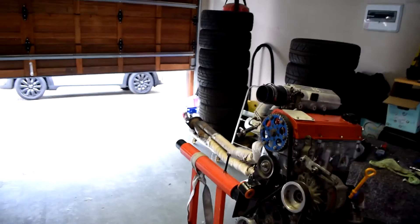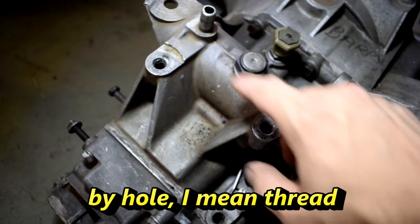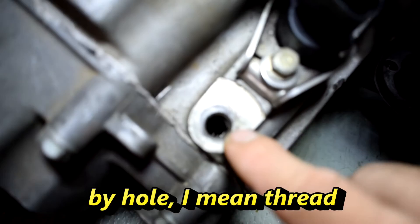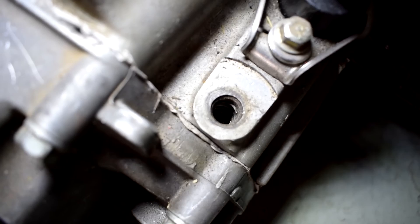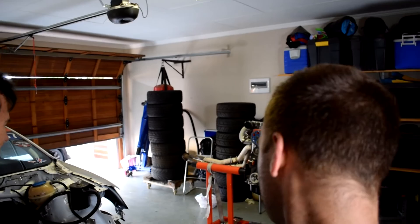That's it guys — unfortunately we're not going to carry on anymore. We've got nothing much more we can do, so we're going to call it. We've done everything we could. Unfortunately it goes like that sometimes. We'll get the rest of the parts in the week. There is actually something on the gearbox — this little hole where the gearbox mounting picks up is stripped, so we're going to take it to the engineers and get it drilled up and helicoiled.